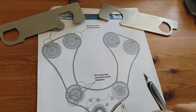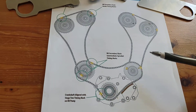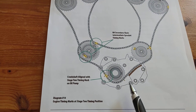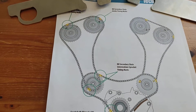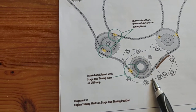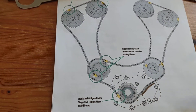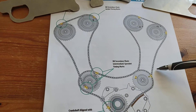After doing this alignment procedure for the LY7 engine the incorrect way — technically the correct way by starting at position one on the oil pump, putting the right primary chain on, then putting this to position two and putting the chain on — I tried that way twice. It caused problems and didn't fix the car.